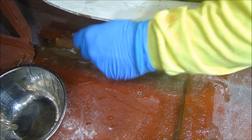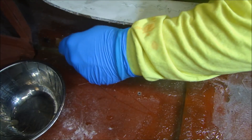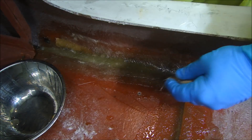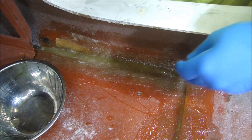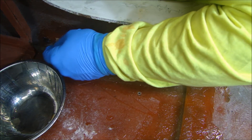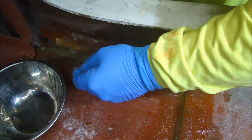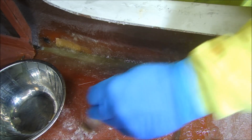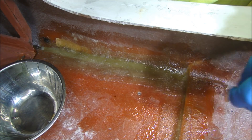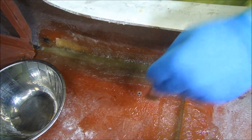As I finish up here, I have plenty of fiberglass matting in there to make up some thickness. Running my finger across, I've got it nice and flat, so I'm sure it will be nice and strong. I don't have too much resin — just going to clean it up a little bit and make sure I don't have any stray fibers. Now we can let that dry and see how it works out.